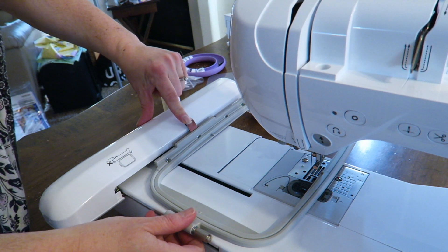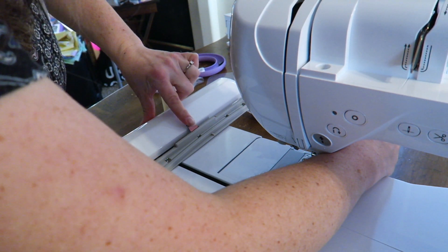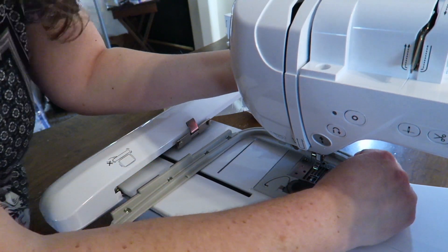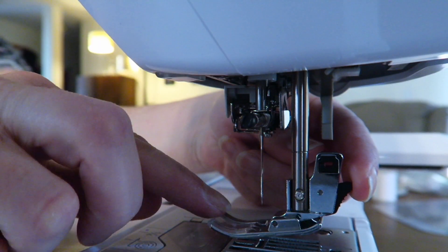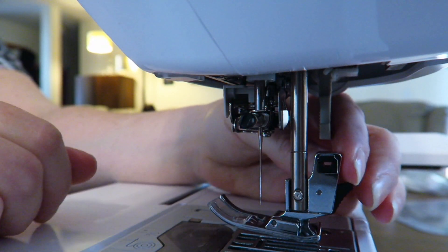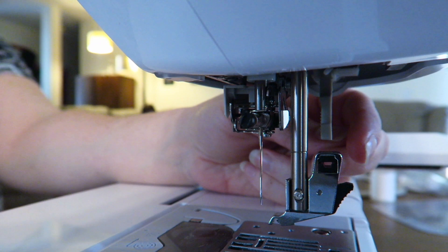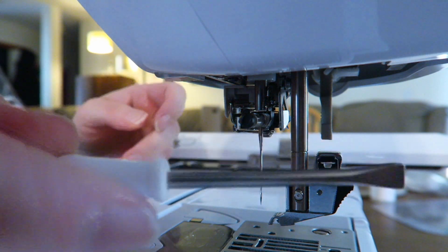This is how we remove the hoop. There's a button right here on the left — your right hand is going to reach through and grab the corner of your hoop. Squeeze with your left hand this button, and then you're going to pull up with your hand. Take your left hand and pull on your presser foot so it comes up. So it's got a little bounce — you slide it underneath and then you've got it. So now we want to remove our presser foot and the whole thing so that we can make it into an embroidery foot. We need to push this button and remove the foot and put it immediately away in our case.